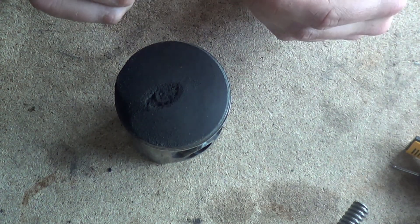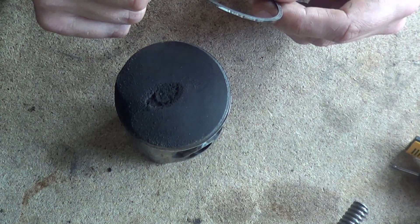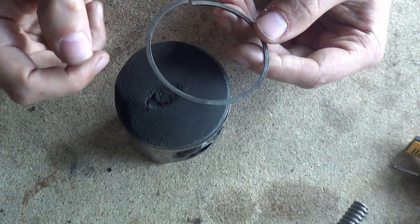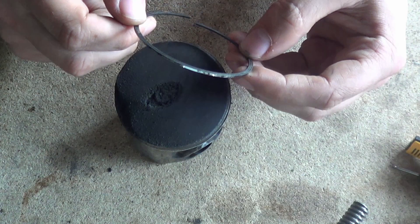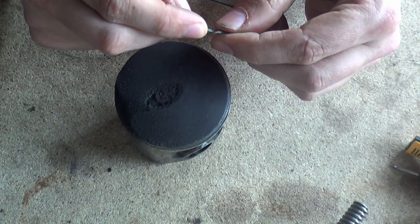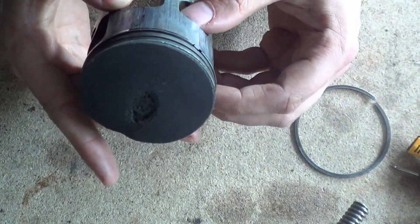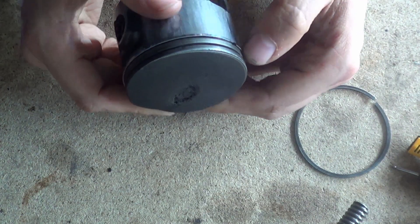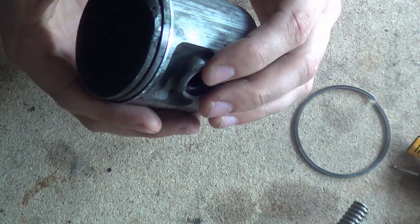There's a lot of carbon deposit on the ring. There are vent grooves cut into the ring — you can see them there. These grooves are cut into the bottom of the ring to help stabilize the airflow on the underside when you have your intake from the bottom of the crankcase. The second compression ring has had the same treatment — just a nightmare.